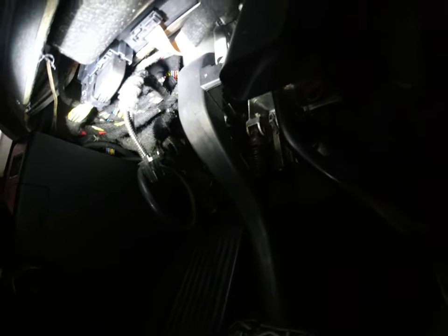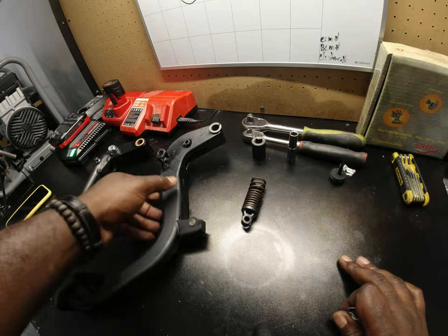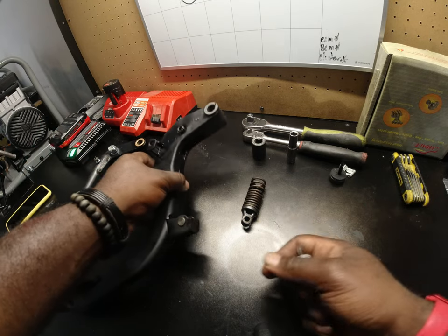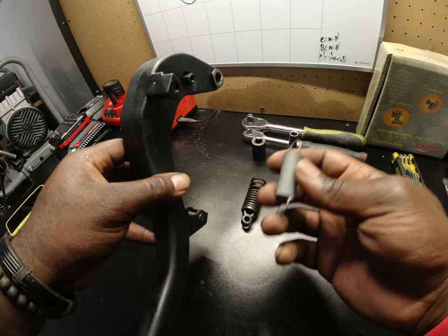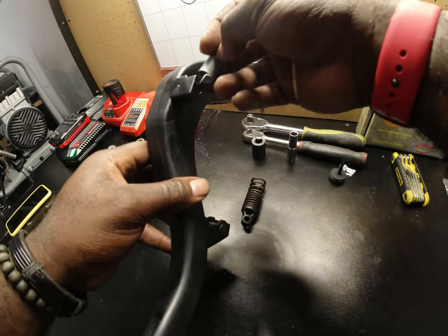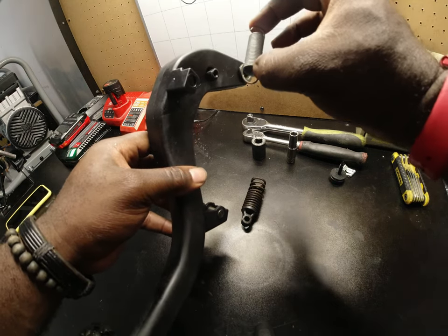The connection for the slave cylinder has to be removed, and then last but not least the one all the way up top for the pedal. It is really tight up there so I'm not able to show a lot of footage, but once I get it out I can explain. We finally got it out on the table with more space and light. The first thing I did was get the spring off — I used a hook, pried it down a little bit, and it comes right out.